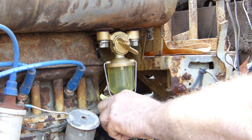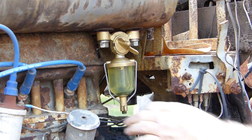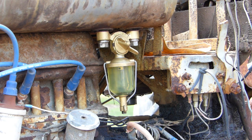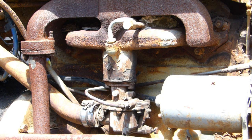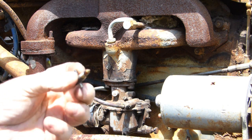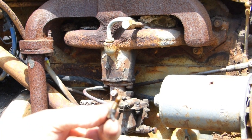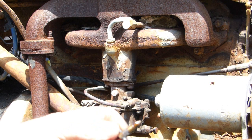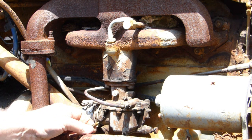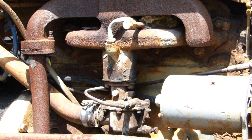So for this moment, we'll run off the front tank and we'll leave that front tank open. And we'll go around to the carby and see what we've got. I've got the drain missing on the carby on the other side. I've actually undone it, so we'll go around there for a look. Well, this is a later carby, the 28G, and just down here there's a fuel drain tap, and the fuel drain tap is so you can drain the rubbish out of the carby. Now, with the fuel on coming into this pipe, we should have fuel just pouring out of there.